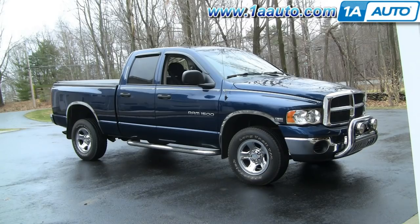In this video we're going to show you how to replace the front drive axle on this '04 Dodge Ram, same as most of these '02 to '08 generation vehicles. Pretty easy. You need a 22 millimeter or 7/8 socket and lug wrench, and you also need a 35 millimeter socket with an impact wrench or a large breaker bar and pipe.